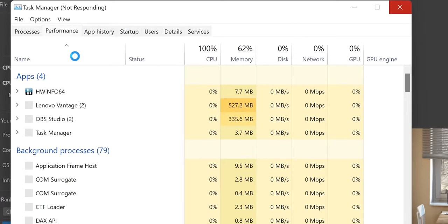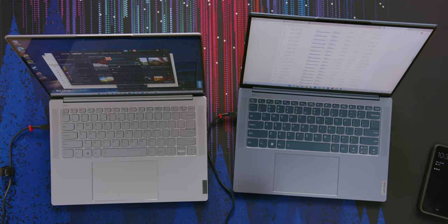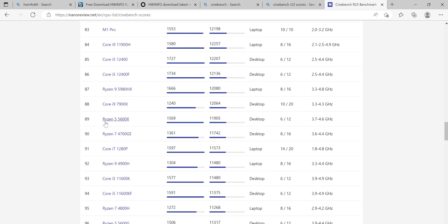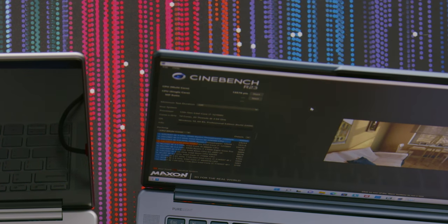It's pretty loud at the moment, and it isn't going all that fast — we're doing all-core 2.4GHz, which sounds slow, but we just need to put that in context. This was able to manage just over 11,000 points in Cinebench R23. For comparison, an i9-9900 — a 5GHz eight-core processor from a couple of generations ago on a desktop — that's comparable to a Ryzen 5 5600X. It's a very competent machine. After stopping the screen recording and letting it cool down, this one was able to do 13,576 in Cinebench. That is great for something this slim. I am genuinely impressed with this laptop.